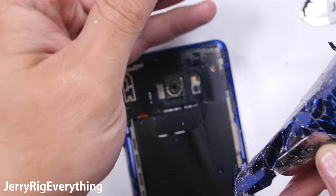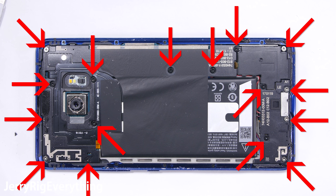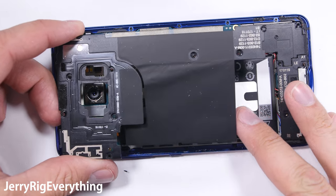But as long as you never break your phone, you shouldn't have to deal with any of those problems. There are 16 screws along the back side — these are all T5 screws. If any of you are actually attempting this repair yourself, I'll include a good tool kit in the video description as well. After the screws are removed, the back plastic panel can lift up.